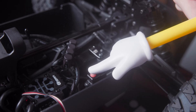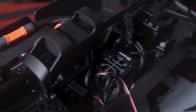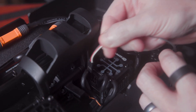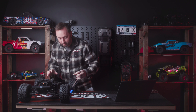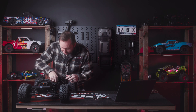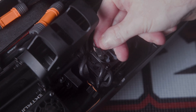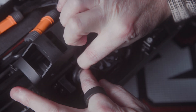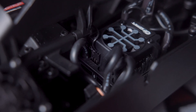Once the upgrade is finished and you've heard the tones, press and hold the power button to turn off your vehicle. Remove the ESC programmer from the ESC by pulling the wire out and set it to one side. Make sure to reinstall the fan connector — that's really important — plugging it in the same orientation you removed it, with the two black wires to the inside of the car and the blank plug facing the outside. With the fan reinstalled, you're ready to power on the car and go.